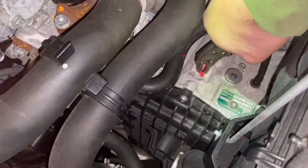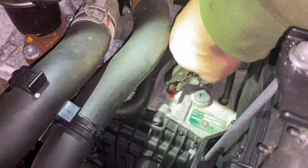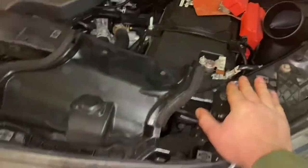You got to continuously hold this thing to keep it in neutral — so that's what it is. This is a parking pawl actuator. As soon as you let this free, it goes into park. So originally what I thought the shifter was, was actually a shifter — I thought you'd go from park, reverse, to neutral, to drive, and click it over a couple times into neutral. But it's actually just a parking pawl actuator and you have to continuously hold it into neutral. You have to turn it to the left, or counterclockwise, and you guys will see that a little bit better in the next clip. Again, all that little shaft is is a parking pawl actuator.